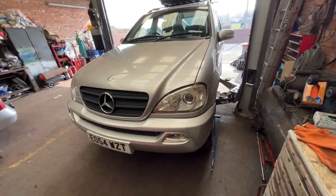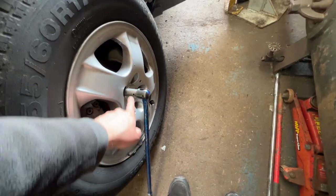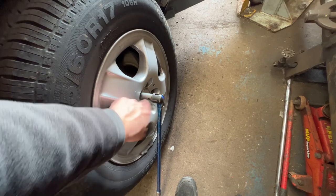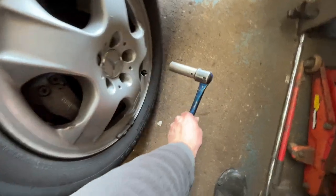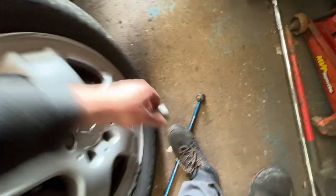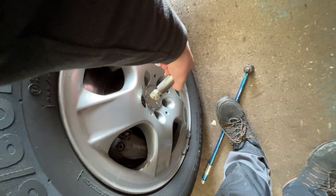The camera decided to knock off there, but we've got it on the lift now. The main key thing for anybody before you take a wheel off: take your locking wheel nut off by hand. Do not use any kind of compressed air or electronic impact guns — just do it by hand. As you can see, I've knocked that off and it'll just wind out by hand, because you'll give yourself grief, especially on older cars, when you snap them.